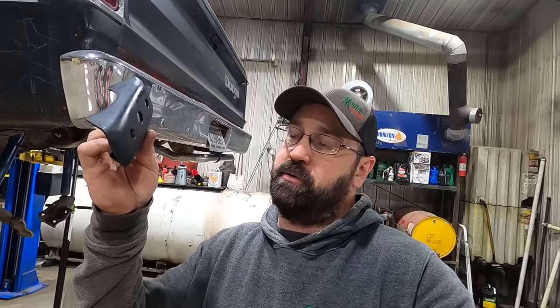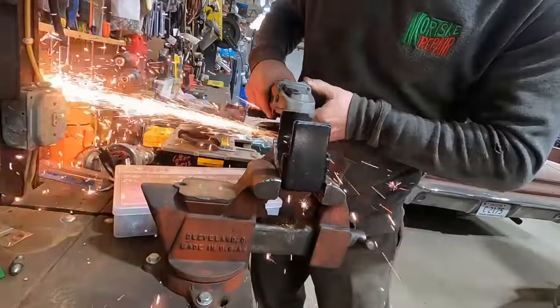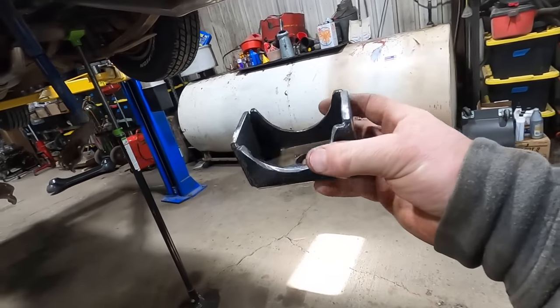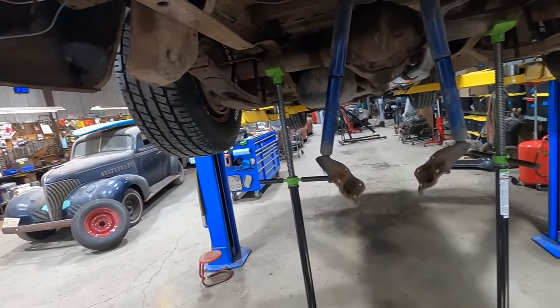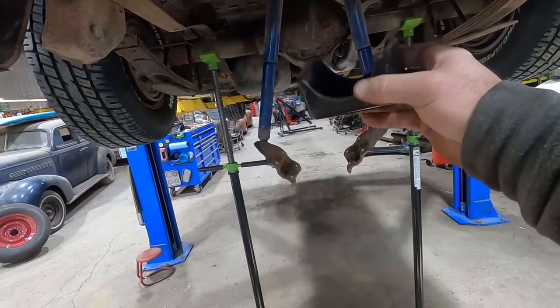So like I said, the right way to do it is get these things, fill those holes in, drill the hole where it needs to be, drill that hole to the right size, and probably flip the bolt up. But we're gonna do a slight amount of hackery here, and we're not gonna put a big weld on there. We can always cut this off and do it right. Right? Right. Now that we got this modified, we're gonna do a little grinding on the diffy tubes, put this in place, set it to the angle it needs to be, and give it a little spot weld.